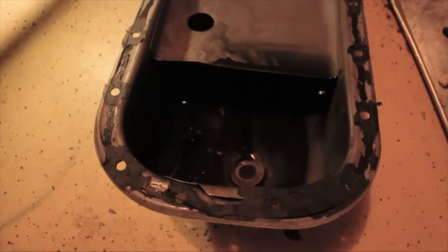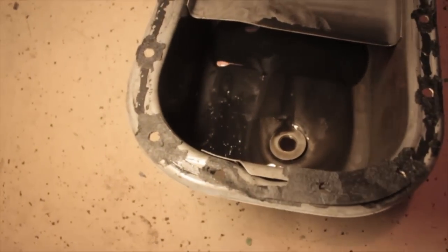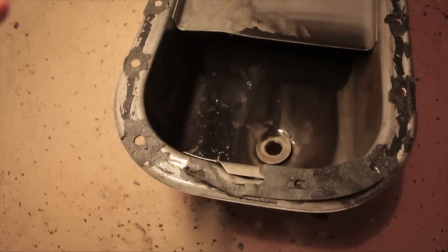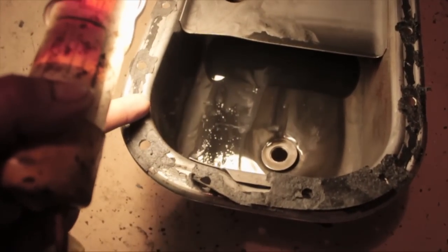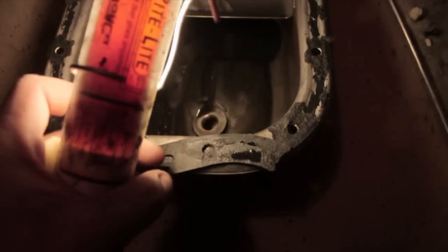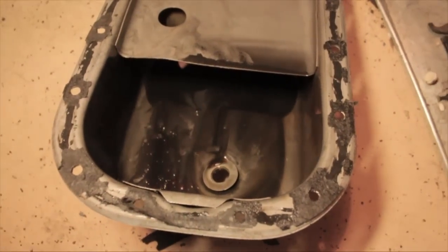This is the part where some forensics come into play. Some of you would say install a gasket dry and do not use any silicone. My problem was that I put too little silicone — you can see the silicone marks here, very thin. What happened is the oil went underneath the paper gasket, which is sealed perfectly to the block but not to the pan. So between the pan and the gasket, it would go under and leak over. Here's a fine example — you can see oil on the underside of this gasket, right on that space. I have plenty of silicone and I plan on using it this time.